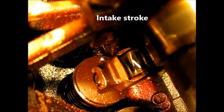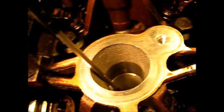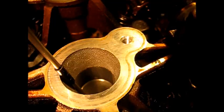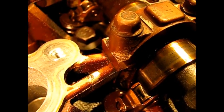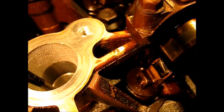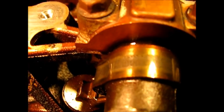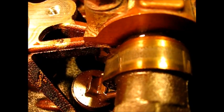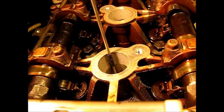Here we go down, going into the intake stroke. See our intake valve popping open, the cam activating it — going down. The cam is off the valve and now we're at the bottom of the piston stroke, at end of intake. Here's our exhaust cam at 11 and our intake cam about 7:30. Sprocket at about six o'clock, having made a 180-degree revolution.